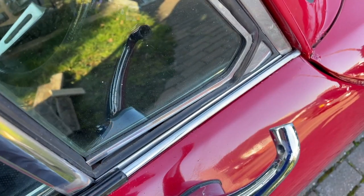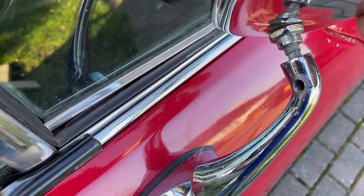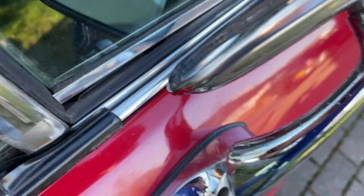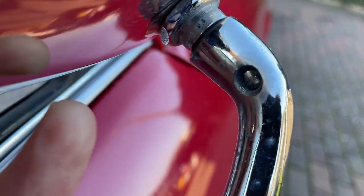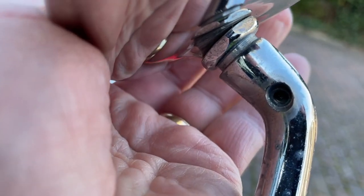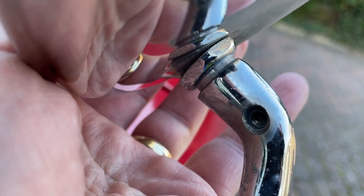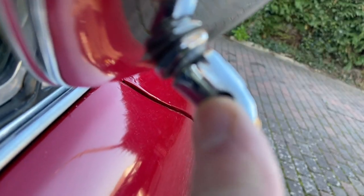And here's a little top tip when putting it back. Obviously you need that hole there to be visible in the stem. So obviously the mirror goes back in like this. And the secret, he says, I'm trying to do this with one hand, is that I've moved this stem forward. So you can actually see now, I can get the hole to match up such that I can get the screw in. Obviously that's the bit I'm trying to do there. We can see my hand, isn't it? So that's what I'm trying to do, is to get that, there you go. If you can see that now, I've actually got the hole lined up with the outer, so now I can get the screw in. Just a little tip, rather than trying to do it in situ, just bend this arm back up against itself and you can see there, you can get right in tight to that.